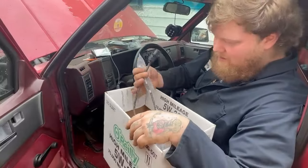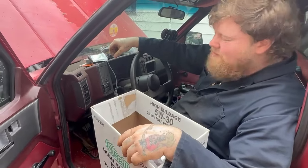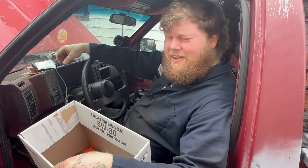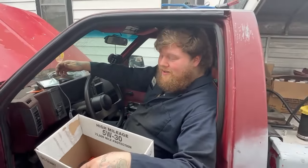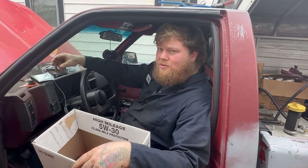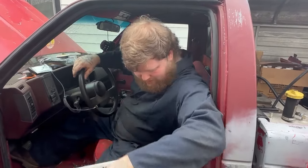It comes with a kit, comes with a plug for it. So all you got to do is run that wire down, run it into your exhaust, weld your bung on there, or use the clamp on style, and then you're good to go. You got an O2 sensor. It's very simple. And if your vehicle already, it was like a TBI or something, and it already had an O2 sensor location, you just unscrew your old one, screw this one in that hole, plug it in and run it. It's pretty simple. It's not very complicated.